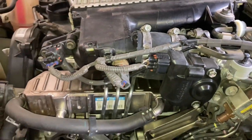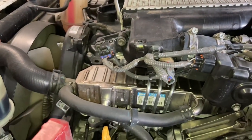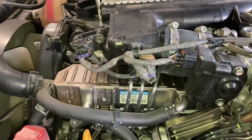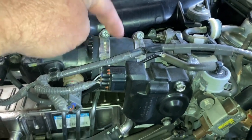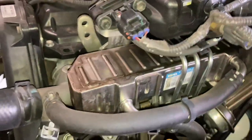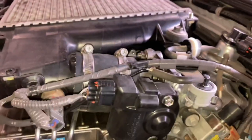I actually thought it was coming from somewhere around here. Normally, this is why you watch these videos — with an oil leak, if you've got a bit of oil somewhere, the fan will blow it back this way, and that's what it'll look like. But as soon as I looked here, I wanted to see a slight indentation from the clamps on the rubber and I wasn't seeing it on this one. So if we've done your injectors and you've got any amount of oil like that, let's have a really good look so you know what it looks like. If you park facing uphill, it's probably not going to be down this end — it'll be back there.